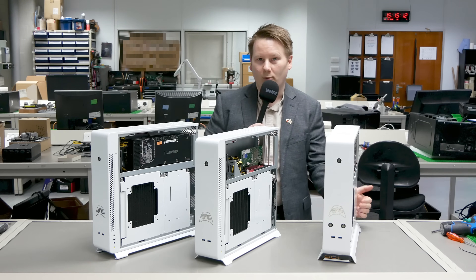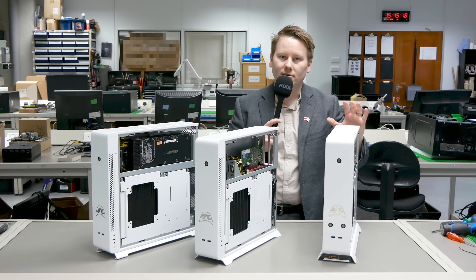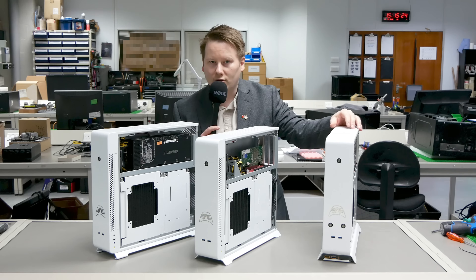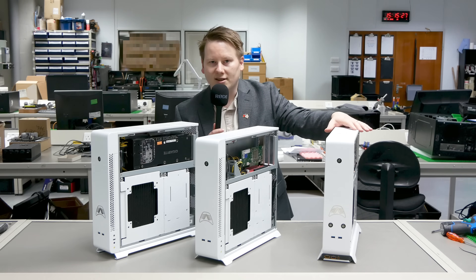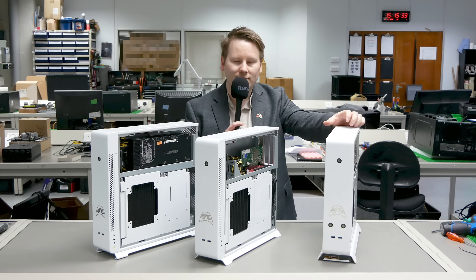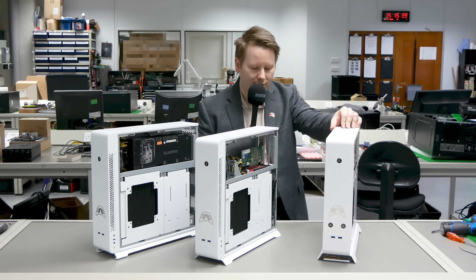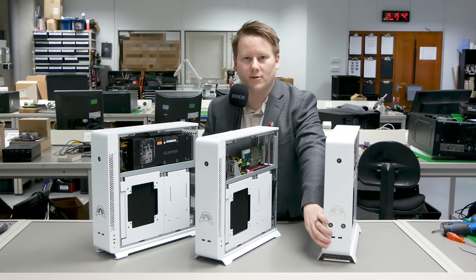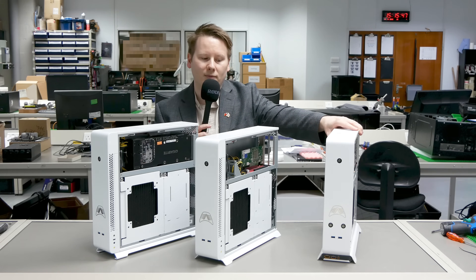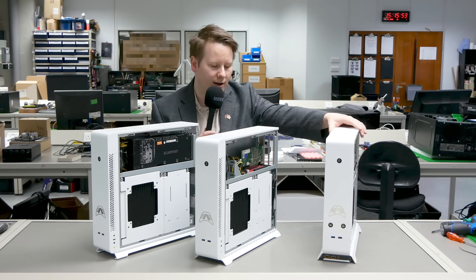One of the interesting things here is that you're using a mini-ITX board, and it's got a custom splitter at the top for three wide PCIe devices. So if you've got a dual slot or triple slot graphics card — or as Dan was telling me, some customers actually wanted high-speed ethernet. These were built at a time when 5GbE or 10GbE didn't really appear on motherboards, so you just add in a card and it does all the cooling for you. At the front there are extra buttons which are custom keyboard controls — one-button macros for those doing VR demos.